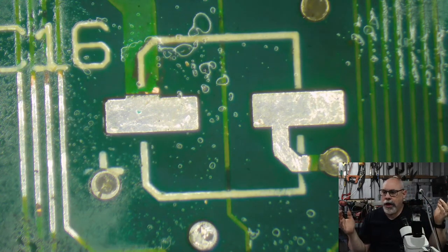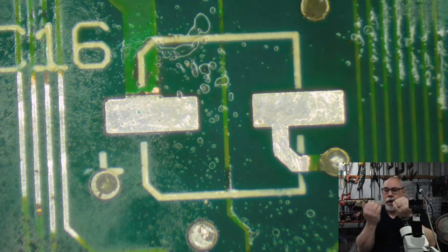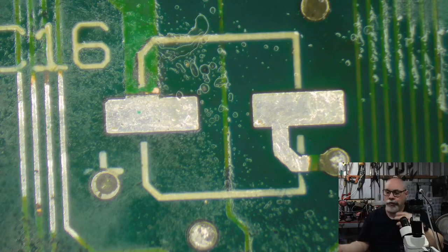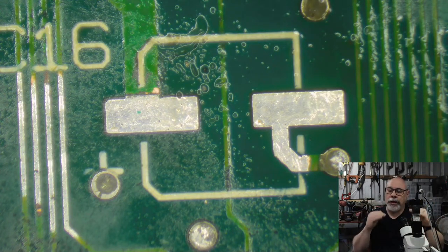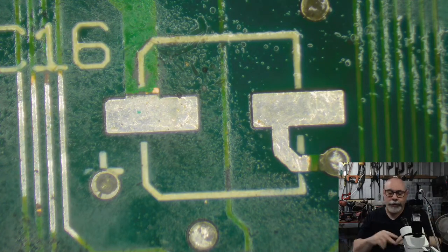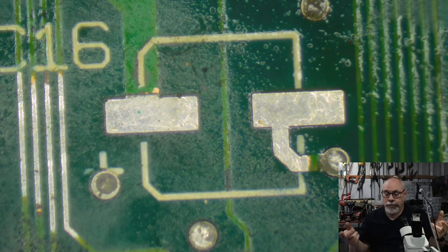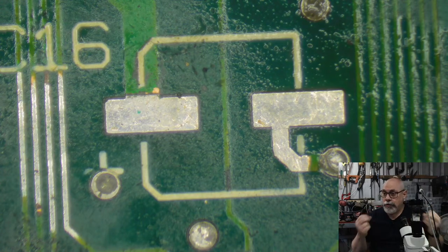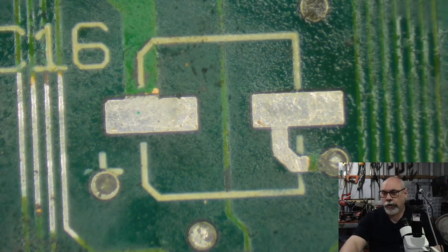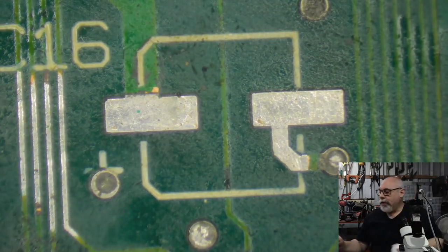Second of all, the other thing is obviously cleaning, because you get a lot of electrolyte around that sound chip, and so that all has to be cleaned out. So you've got to make sure that's really, really clean, toothbrush and alcohol, whatever, get that as clean as possible. Now, after all of that, if you're still not getting sound, then it could be rotted traces around the sound chip that you need to repair, or the sound chip has failed altogether. I've had that happen on a few of them as well. They get shorted out by the electrolyte and then they stop working. So that's the whole thing with the sound.